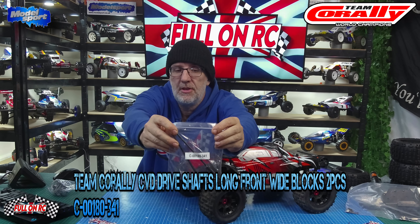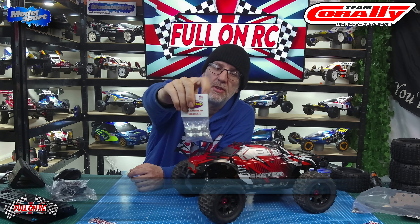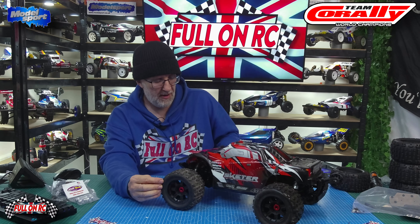We've got the wider rear hubs, and you also need the extended drive shafts — these are spring steel. I also bought some M2C Plus 10mm hub extenders. I'm not overly keen on putting those on because I think they add stress to the ball joints, but we'll see how wide it is once we've done the modifications. Currently the car sits at 14 inches wide.